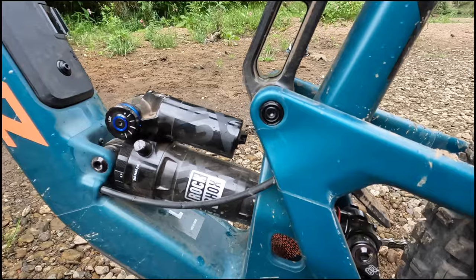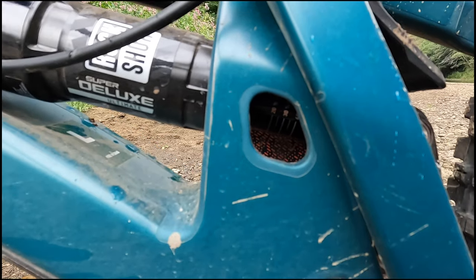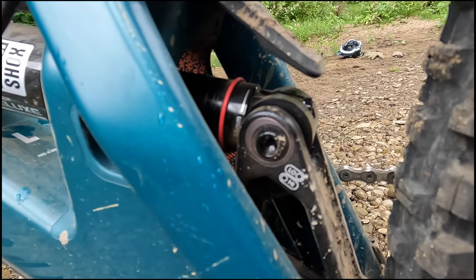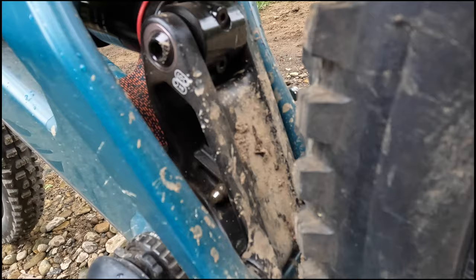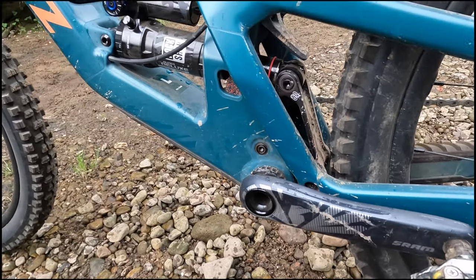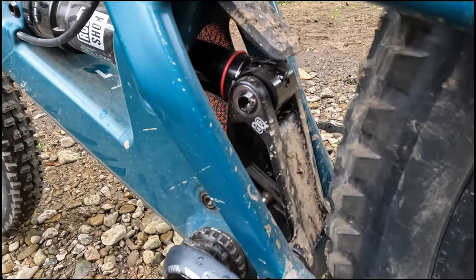On the off side of the frame you can see those smaller pivot diameters again, giving more space and dropping everything closer into the bottom bracket. There's also a little window in the part of the frame that straddles the rear shock, so you can actually see the sag ring when adjusting sag — making it a lot easier to set up. On the back you've got a little eccentric mount so you can change the geometry by half a degree just by flipping it around. And right down at the bottom there's a grease injection point — you can pump the bearings full of fresh grease without dismantling the whole bearing.